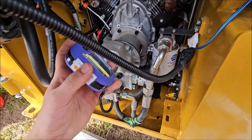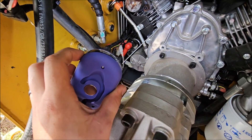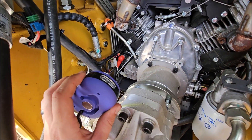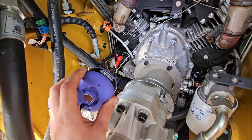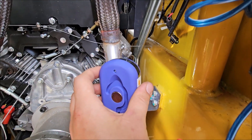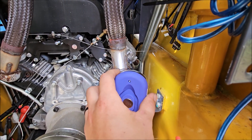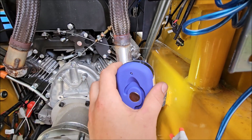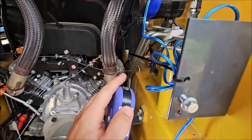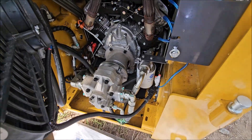Back in here there's a bunch of wires. I zip-tied them all together and pulled them off so they're not touching those metal hydraulic hoses and not touching any of the hot engine components. Right there was a spark plug wire touching and rubbing on those hard hydraulic lines — it was getting melted and rubbed up. There was some electrical back here that was getting melted as well. I just pulled and zip-tied it to parts of the frame over here to get it all off, because within 10 hours those would have been burned through and blown up.